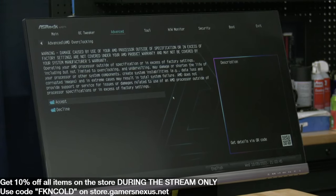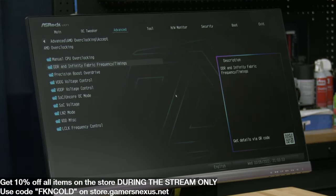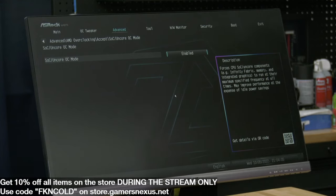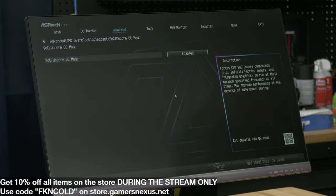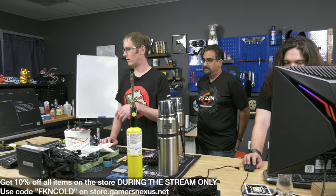In the AMD overclocking menu, all the DDR voltages are already set up. I'm going to check SOC OC mode - it looks like Nick enabled that. What this does is disable all of the DF and memory P-states, so the memory and the DF will run at a fixed frequency rather than trying to go to a lower power idle state. Having memory and fabric at fixed speed also means your GMI links - the links between the core and the IOD - stay fixed as well.